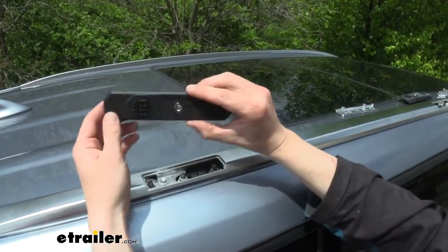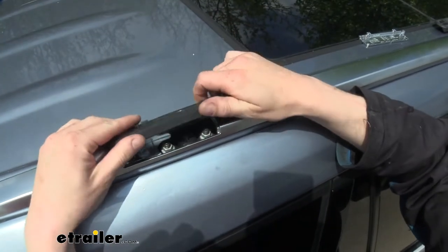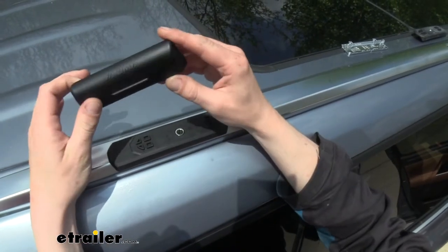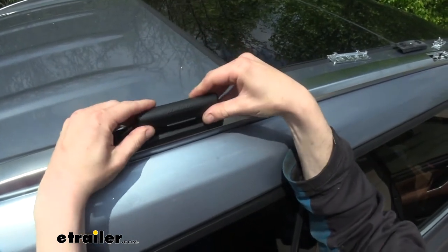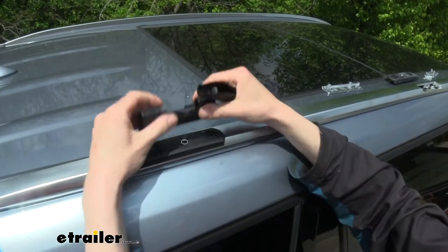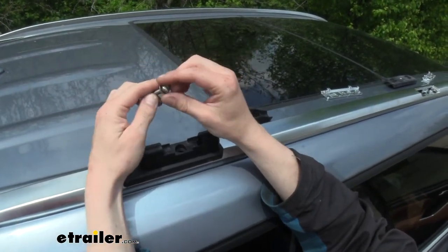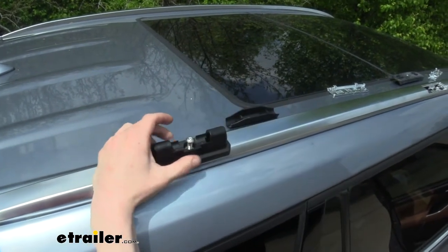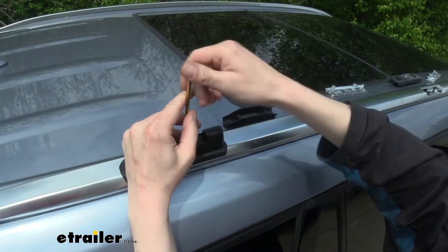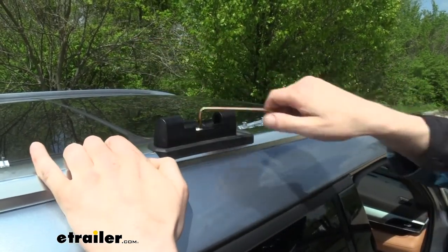We're going to put our B up by the front one, and take the A at the back — you'll see there's a hole right on top that's going to line up with the hole in our landing pad. It's just going to sit into place just like that. You'll then have the upper attachment point, which sits right on top, and you also want to be able to read the Yakima logo. Open it up — it's a little stiff. You'll see there's a hole in this component as well. We'll take the hardware from our kit, put one of the washers on it, slide it down in there, and then use the included tool to run it right down into the top. There's a little bit of Loctite on your bolt, so if it feels stiff at a certain point, just be careful and push past that.